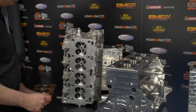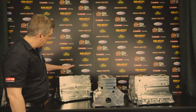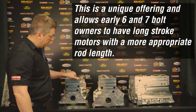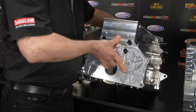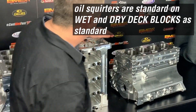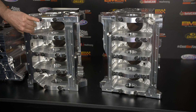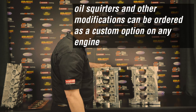If you can add a 6mm longer rod that brings the rod-to-stroke ratio back. We supply this for all three blocks, which is unique for the 6 and 7-bolt blocks because they were never available in a 4G64 option unlike the Evo — so that's another advantage of going to a built block. All of our blocks also have the oil squirter option. In a factory 4G64 block they don't have oil squirters. The oil squirters are only available in the wet and dry blocks — they're not put into the drag blocks because of the short duration nature of drag racing, unless someone specifically requests it.